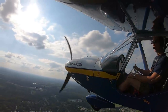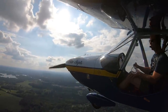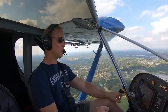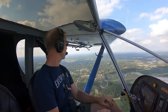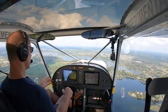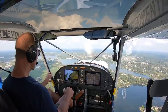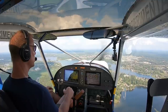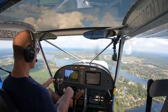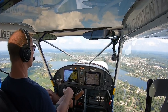Now I guess I'll just go have a little bit of fun until Gordon decides to get his butt out here in his airplane. Is his door open yet? No. So my consensus is this stiffener plate on the panel really, really made a big difference. I like how the throttle feels solid now — it doesn't move all around. It looks like I can now have a position on the friction lock to where I can leave it unlocked and move the throttle, but the return spring on the throttle body doesn't bring in the throttle. I have a feeling it's because it's not vibrating like it was before. That was a really good improvement to the airplane.